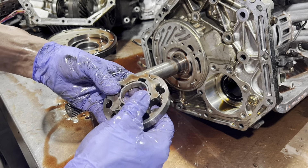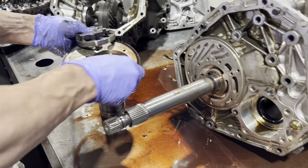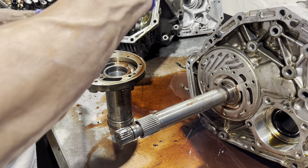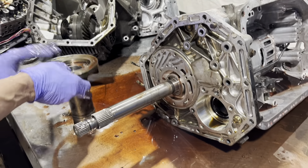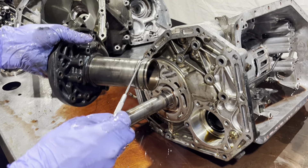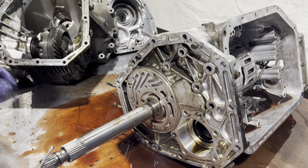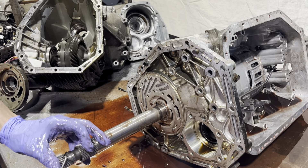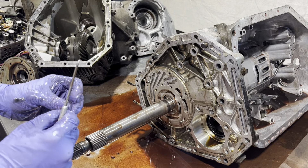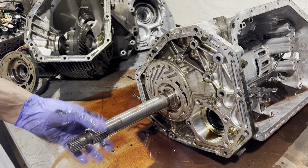There's a bushing in here and another bushing here, along with an O-ring that goes into this groove when you put it back together. Additionally, you're going to have two more O-rings here and your lock-up O-ring. This is important — always change this one for sure. The torque converter gets very hot and this seal gets flattened out, giving you converter slips and things like that.